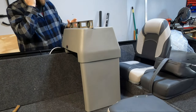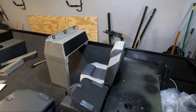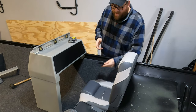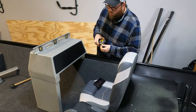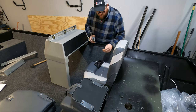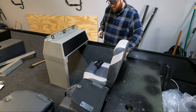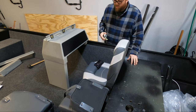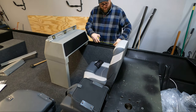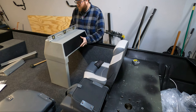Really happy with this. Let's go ahead and start getting everything spaced out based on my measurements. I took a whole bunch of measurements to try to get this to fit the best I can. The Bass Tracker has a 26 inch wide console; this one is 25 inches, so we're pretty close. The console is 31 inches from the rear deck — I measured from the back of the rear platform on the Tracker to the front of the console, which measured out to 31 inches — so that would put it a little further forward. Let's go ahead and move this a little forward.